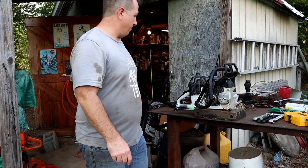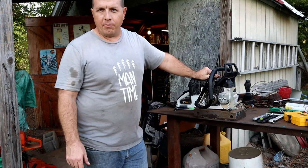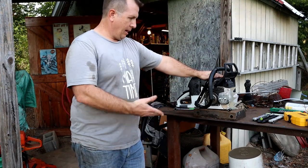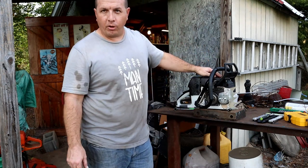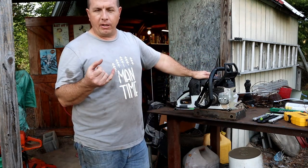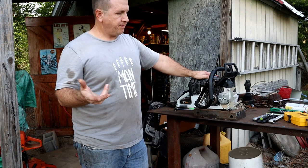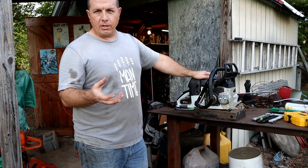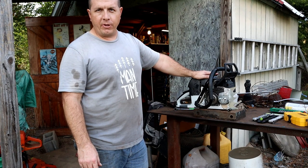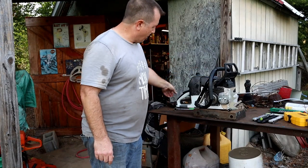These clone saws, man. But yeah, if you've got this thing on the job and it's not pumping out any oil, and I guess only working sporadically, that's not really going to work for you. Other things that fail on them: electronics, carburetors, and rubber. So that's fuel line, oil line, impulse line, boots, anything like that. That stuff fails a lot sooner than OEM.